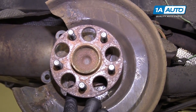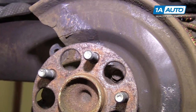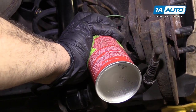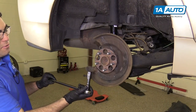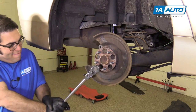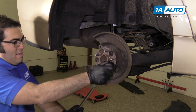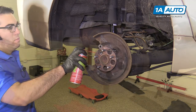There are four bolts holding in the wheel bearing — two on the bottom and two on the top. You'll have to spin the hub so you can have access to them. Before I try to remove them, I can see some of the threads from the back, so I'm going to spray some rust penetrant. It needs a 14mm socket, a short extension, and a long ratchet. We'll go through the opening in the hub. Spray some rust penetrant in here and finish removing the bolts.